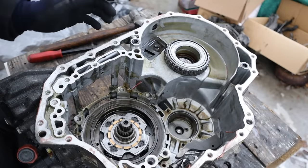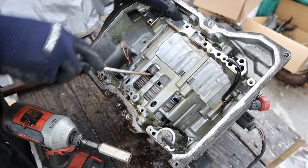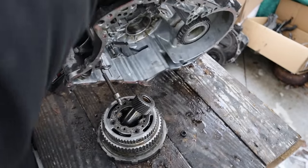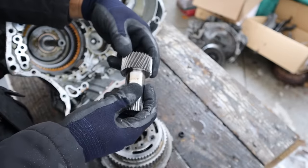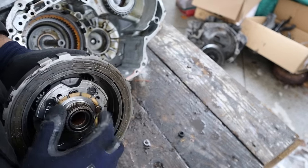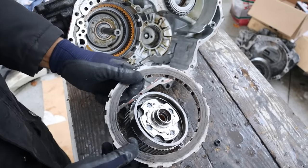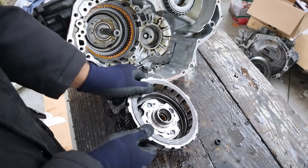Let's just take off the snap ring — at least I don't need pliers for that. They give you nice side access here above the valve body where you can just pry things and pull it out. A whole bunch of parts came out. Here we got another planetary gear set inside of there — it's got a lot of planets on it, and then there's this sun gear. We've got the sun gear for the rear planetary and this would be the sun gear for this planetary gear set. So it looks like we've got two planetary gear sets here, and I think we might have a sprag here. This is a sprag gear — basically it's a one-way drive, so it only allows it to rotate one way and resists torque in the other direction.